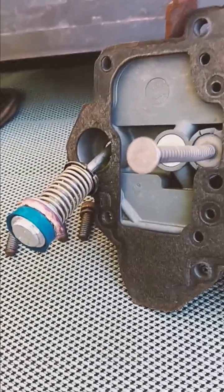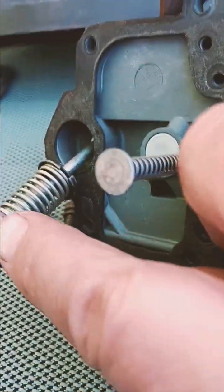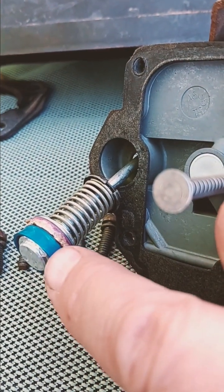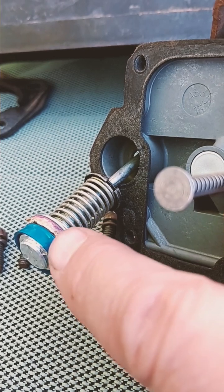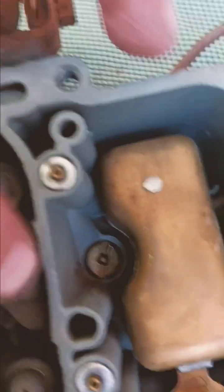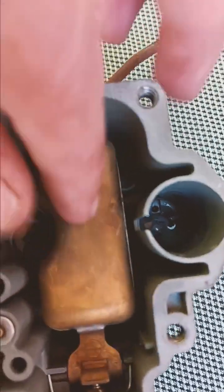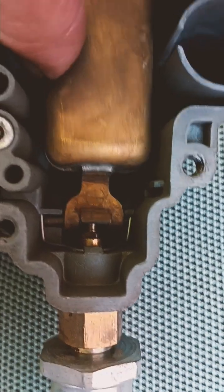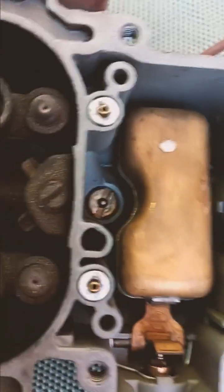Here are the top covers off, and you can see the original, theoretically rebuildable, accelerator pump. It had a rubber boot which was trashed and I couldn't find the right one, so I stole this cup off of an accelerator pump that otherwise wouldn't have worked. It would have been too small, but by having bits of leather in there it pushed it out enough that it more or less works, just not well. You'll see the power valve right down in there. This is the float — this one happens to be hollow brass. As this comes up, you can see that it pushes against that little needle, which then closes the seat and keeps more fuel from coming in so it doesn't overflow the bowl.